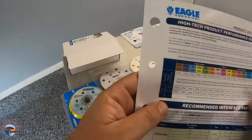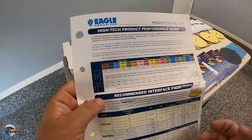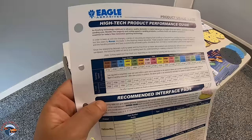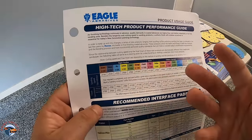Let's check out a couple of cool gadgets that go along with the K system. When identifying the K system, we have a reference chart that tells you the equivalents. For instance, a K600 will cut like a P320. A K800 will cut like a P600, but still leave that 800 grit scratch that we'd see in the P system. We also have a backing pad which is a little bit flexible, and we'll be putting this on our 3/32 stroke DA for the K system.